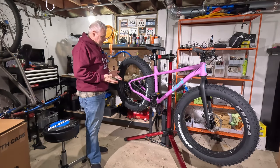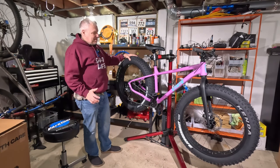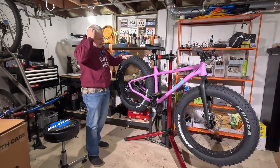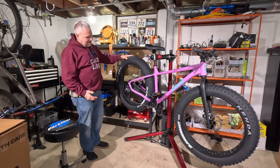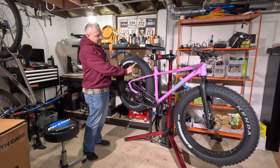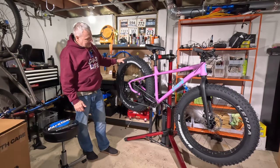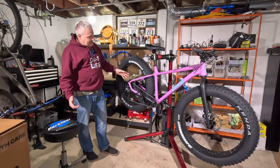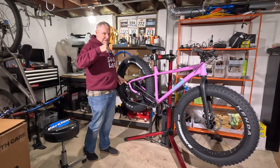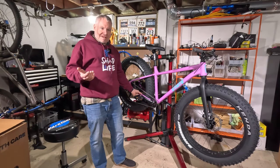There are a couple of upgrade options if you want to improve this bike. The first thing I'd start with are the tires — they're going to be really heavy and will detract from ride quality and pedaling effort. As cool as the tread pattern looks, they're just too heavy. You can get a 60 TPI or 125 TPI folding bead tire and I bet you could take like three pounds off this bike just in tires alone. I'll have some quick-release wheel upgrade options in the description.